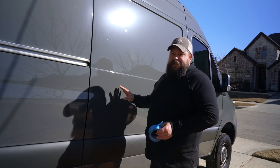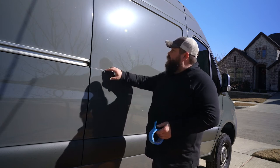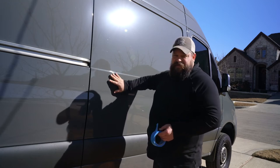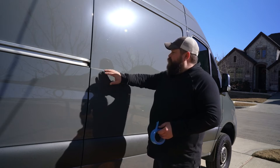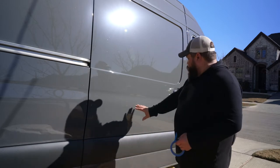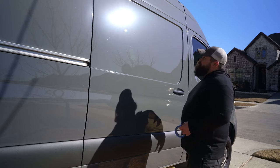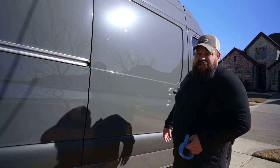Masking the paint is very important in this step. When we're cutting, the shavings are going to be falling and they're going to be hot. We don't want them to get trapped in the paint and cause rust issues later on down the road. So we're going to mask off and use this craft paper to cover the paint — that should help protect a lot of this.